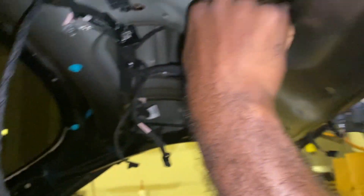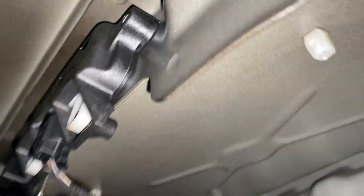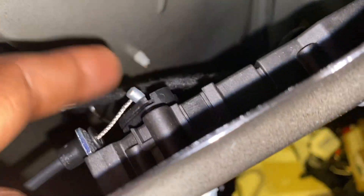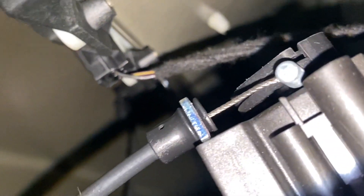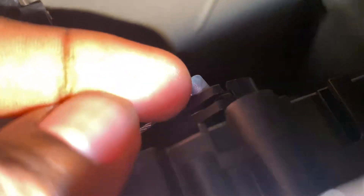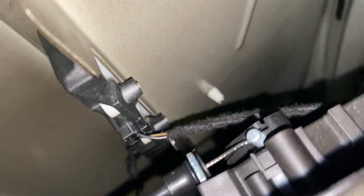The last step — the most important step. This is what gets you actually operating. Because if you close it again after those steps it won't work. So up in here you're gonna see this little thing connected to this piece — give it a good tug to see if you can pop it open. If you can't, use the emergency release: go in here, you see this little groove right here that bends in there like a brake on a bike. Pop that out and you should be functional — you should get your trunk back. Just leave that like that.